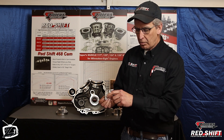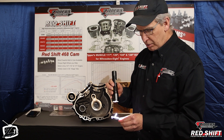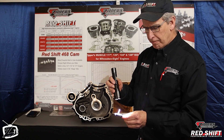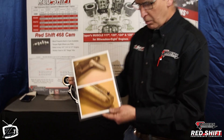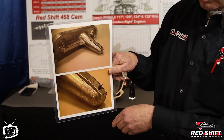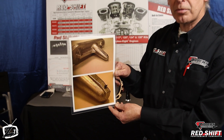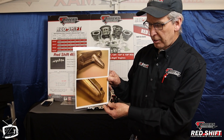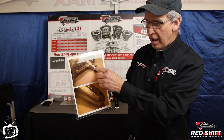If you found debris in your oil tank, your oil pan, or when you removed the jet, you should replace them — because once something gets lodged inside there, you're not likely to be able to do anything about it. There are times we have seen the piston jet is actually clogged shut. I have a picture here with magnification to demonstrate: that one-millimeter feed hole is blocked completely shut. This is from two separate engines and we're starting to see more of these. That jet needs to be replaced because it's not going to oil properly, and we don't know what's stuck inside the canal or the check valve.